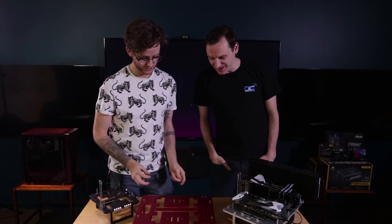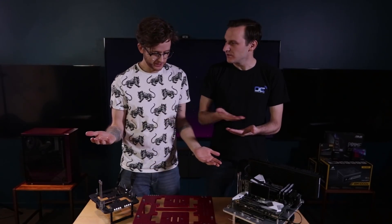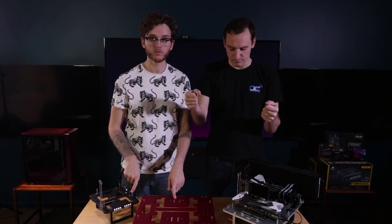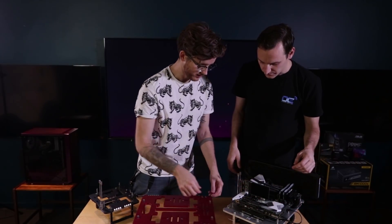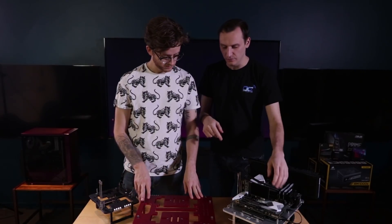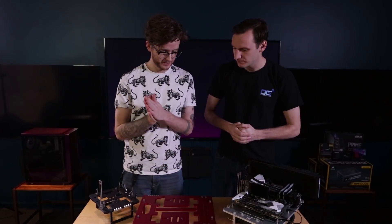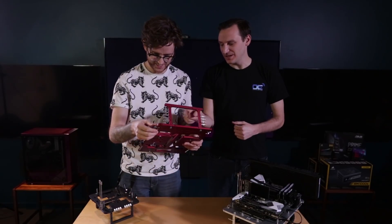The tricky part now: you can't put the motherboard straight on this, because you'll have contact between the pins underneath and it'll short it out. So we have standoffs and push pins — there are two ways of doing it. Either you take the push pins like we did on the mini, which are plug-and-play: you can just plug them out and put them back in. They still hold the motherboard but make it easier to swap. Or you can take the regular standoffs, which are the same ones used for the PCI Express stands, and screw the motherboard down.